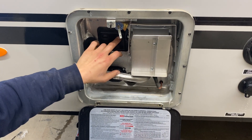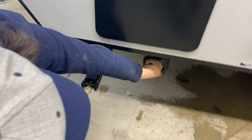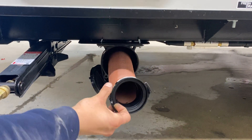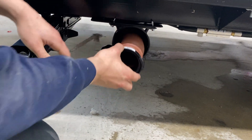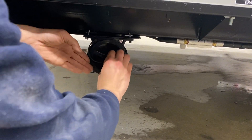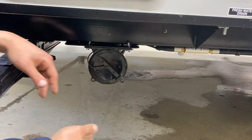The reset button I'll refer to is just right in here. Also right underneath we've got a sewer hose compartment — pop off the end cap and your sewer hose is stored in here. Same two ears as your caps, it attaches the same way. Once fully extended it's about 20 feet long. The cap presses into place and a little turn locks it in — you could also get a little lock in there to secure it.